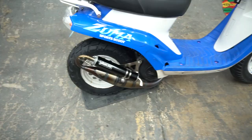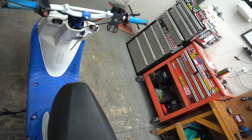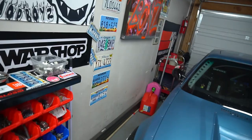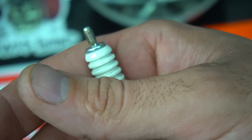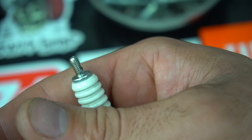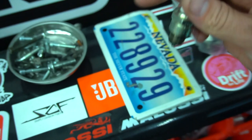All right, new tires on there, pipes back on there. Check real quick if we got an exhaust leak. Put a new plug in it too, because I noticed that it happened on my stroker lead a lot. The plug got like flattened. And look right there. That big flat spot, that's where the clip was. So the clip rattled around until it literally flattened out the actual part of the plug.